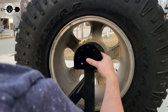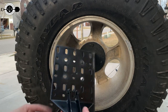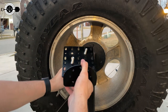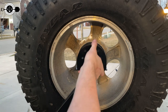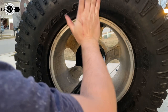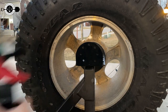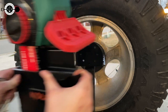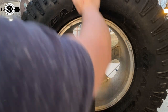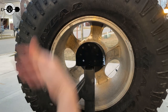What I'm going to do is put the mount like this. I used my drill press and just widened out these four holes. I'm going to put these U-bolts in an X pattern around this post to hold this onto it, and then put the chainsaw mount here behind the spare — just enough room for the chainsaw to sit behind the spare. It should be low enough that when I swing this closed it will come in below the rooftop tent and be totally out of the way, basically hidden behind the spare tire. To access it I would just swing my spare tire carrier out, get the chainsaw, and be good to go.